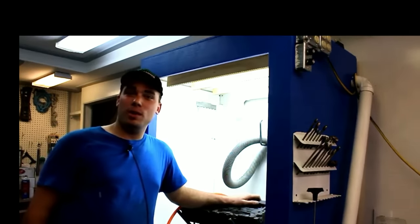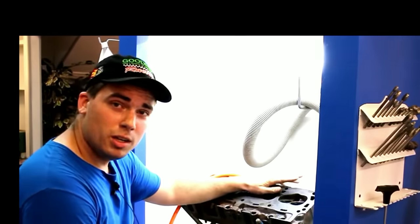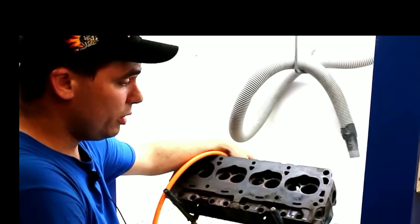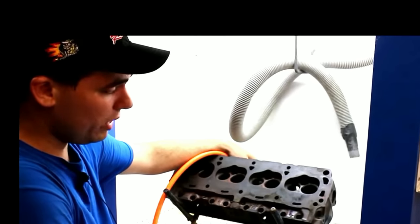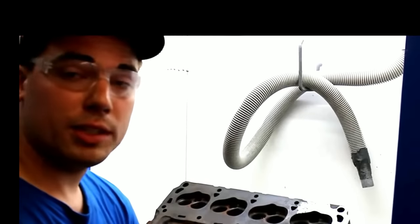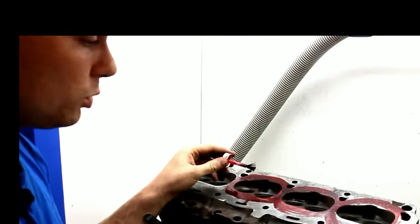Hi, I'm Philip Stillwell, known around here as Iron Icon — we'll get to that a bit later. What we have here today is a 289 casting off of a 66 Mustang. The reason we're going with this particular casting is because I want original iron in the Mustang I'm restoring. The head was in very bad shape when we found it — covered in rust and needed to be cleaned really well. We ended up acid dipping the head, which is the reason for this black finish. Right here we're cleaning off the deck surface after acid dipping so we can scribe for the chambers, putting some Dykem on so we can scribe our lines with the head gasket bore.